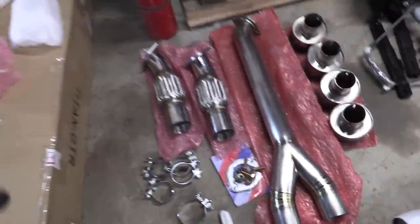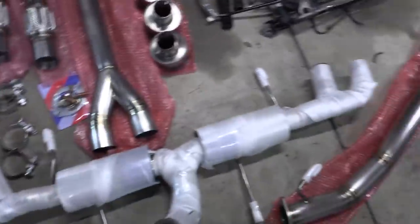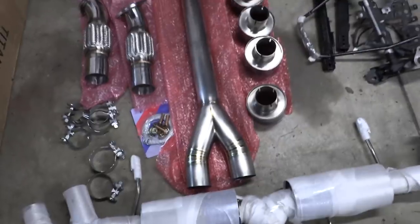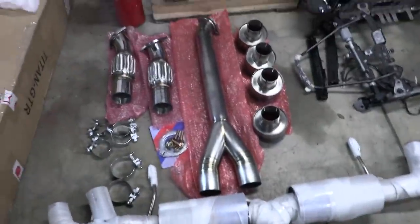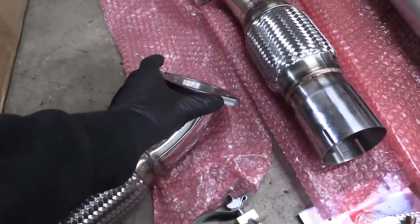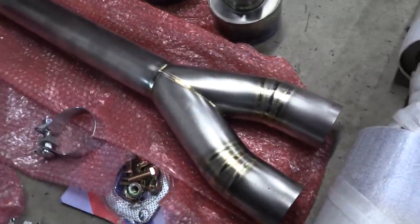The downpipes I just installed are stainless, and these connecting pieces are stainless too. Every kit I've looked at has those made out of stainless — there must be some reason to it. There probably are full titanium ones but I couldn't find any. The rest of this stuff is all the titanium bits — titanium tips, titanium mid-pipe. This is so crazy how lightweight this stuff is. Stronger than stainless, and much, much lighter — I think it's even lighter than aluminum, don't quote me on that. These pieces connect up to our downpipes with gaskets, nuts, and bolts right here, then slip over where the titanium starts, and we're gonna use these collars to cinch it down.